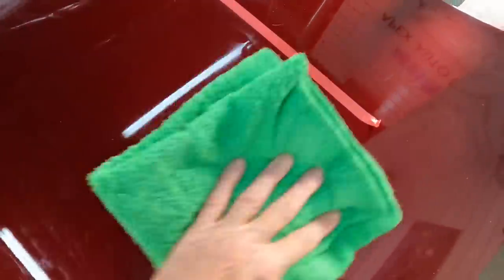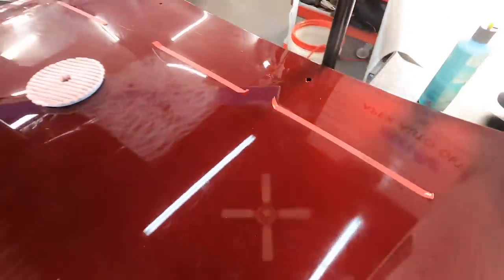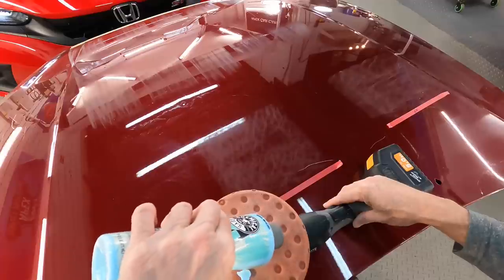I can tell you it does have an impressive open time and cycle time — there's plenty of lubrication there to do as many passes as needed. There is no dusting whatsoever, which I love. Let's wipe off the residue and see how the cut is. With this pad — which isn't very aggressive — it does a fantastic job. Another pass or switching to a more aggressive pad would make it perfect, though it will need to be finished down. The clear coat hardness is medium, maybe slightly below medium on this hood.